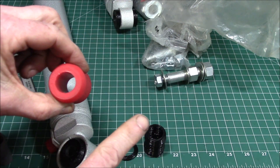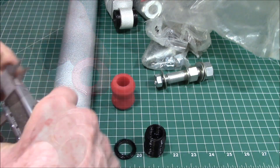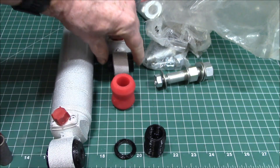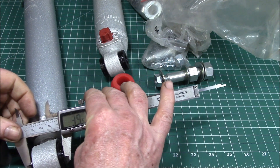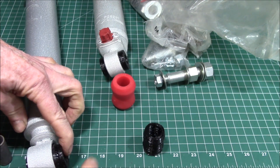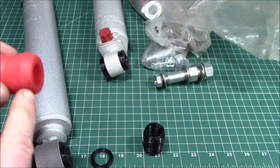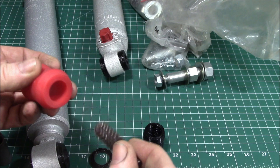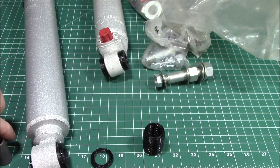You can get 20, 18, 16, 14, or 12 millimeter, but not 19. This one is 40 millimeters — so this one and this one are the same width. The lower shock mount is 40, and the upper one is 39 millimeters, plus a 4 millimeter spacer to make it 43. The other one is about 45 millimeters, so you would need to shave down one side and hog it out with a die grinder.